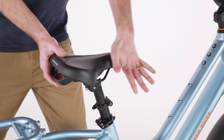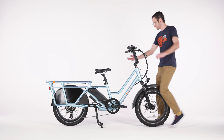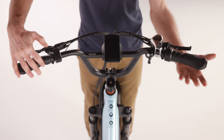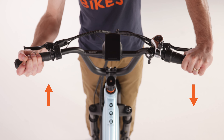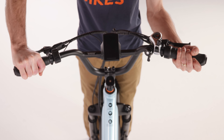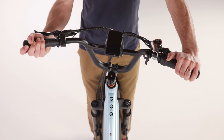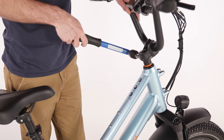There should be enough resistance to leave an imprint in your hand, and the seat post should not move once the lever is closed. Perform a handlebar twist test by standing at the front of the bike and bracing the front wheel between your feet and lower legs. Hold both handlebar grips and push forward with one hand while pulling back with the other, with about 20 pounds of force with each hand. Check that the handlebar doesn't move out of alignment with the wheel. Then switch hands and repeat with about 20 pounds of force. If the handlebar and stem rotate out of alignment with the front wheel, check the tightness of your stem clamp bolts and tighten if necessary.